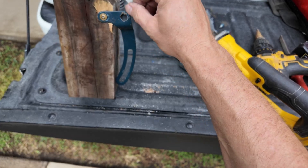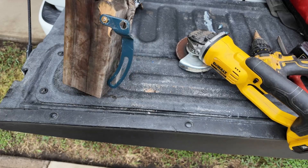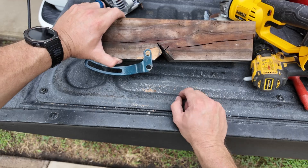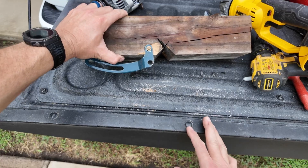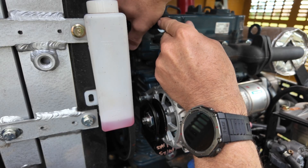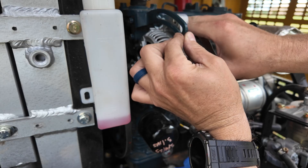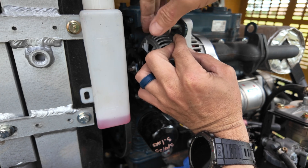Last thing I need to do is take that little notch out of the corner so it doesn't rub up on the upper water jacket. I'll use a flap grinder — it should make quick work of it. I don't want to go too far into the bolt opening, just in case it ever backs off and things start to swing. I'll do these bolts hand tight so they still have a little movement, then move the alternator up, get that bolt in, and snug everything up. Looks like that did the trick.